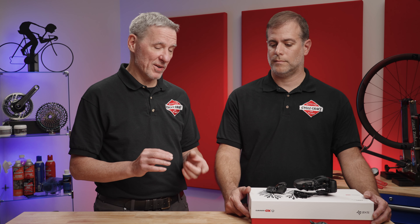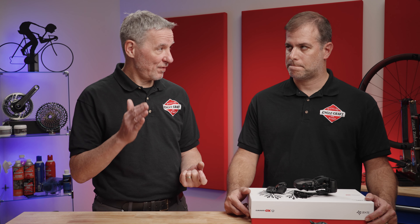Now if I really want to go the full Megillah — I want the 12-speed drivetrain with the full wide-range Eagle buttery shifting — that would be with a 10 to 52 tooth range cassette. What do I need to change on my bike to make that happen? In order to make that happen, we would have to change your wheelset to get the updated XD driver body.